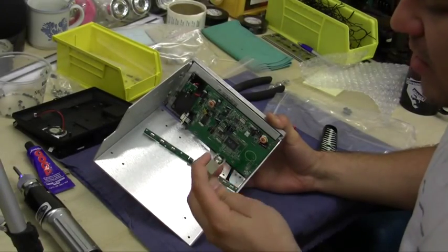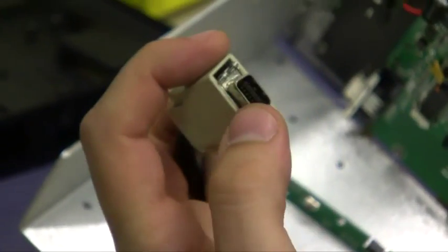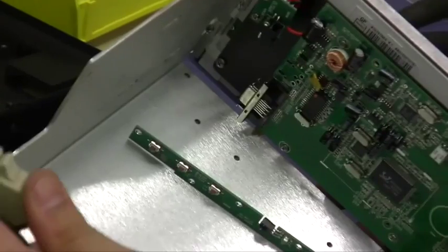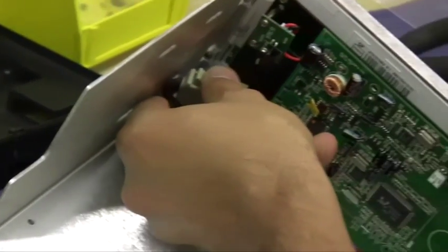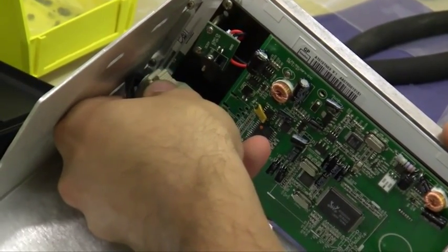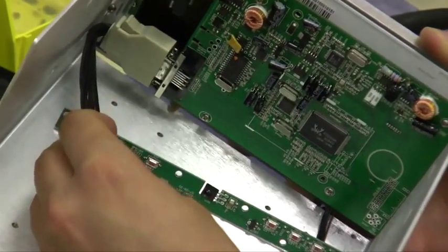So now you're ready to attach this to the PCB board. If you can see this connector, there's a short side and a long side. The long side is going to be towards you when you slide it in, and the short side is going to be towards the LCD part on the inside. So you're going to take this, fold the cables towards the plastic, and align the outside or the long side first, then just kind of slide it in, slide in the back side. Once it's aligned with the onward connector, you just gently slide it all the way up so that the sides lock in.